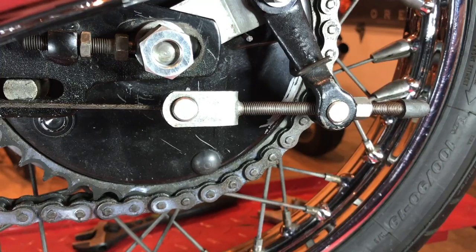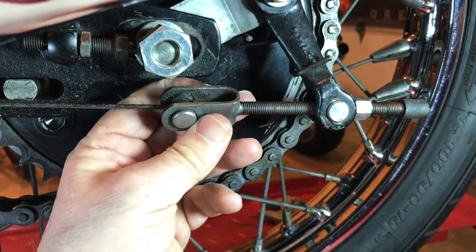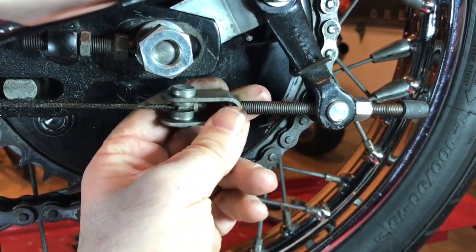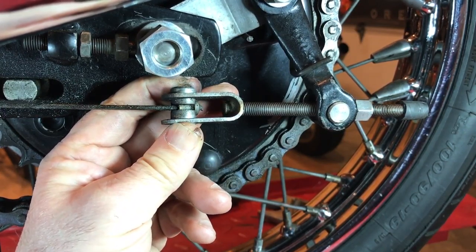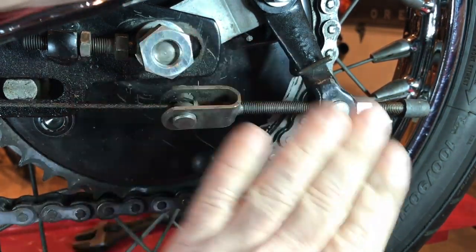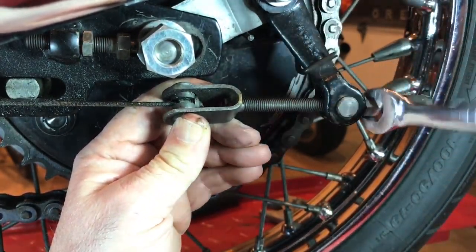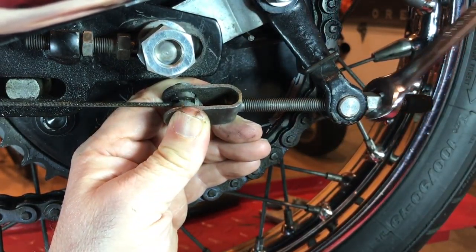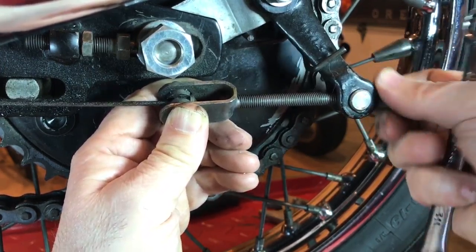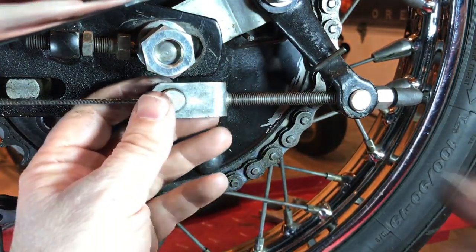Here on the left-hand side of the bike I'm going to remove this brake cable by slackening off this adjuster nut, which will give enough slack in the cable to allow that trunnion — and the cable to go past the trunnion and release. Don't you just love that word, trunnion? The nipple of the cable should go beyond that recess in the trunnion and allow it to come off, releasing the whole mechanism. I'll tighten this up appropriately when the wheel goes back on and readjust the brakes when everything goes back together again. I've put a little bit of rubber tube on there just to protect against knocks and dings, so hopefully that's enough slack now.